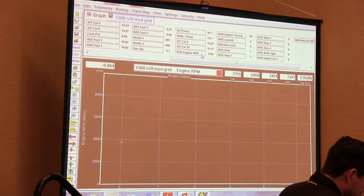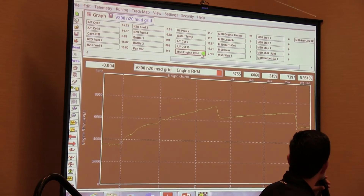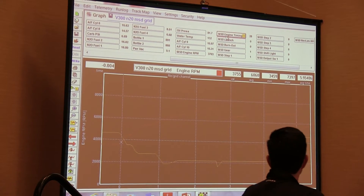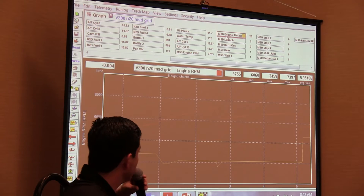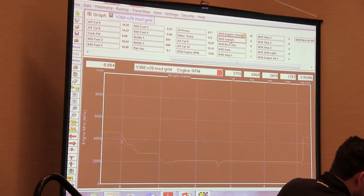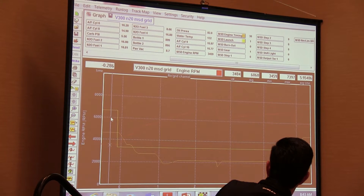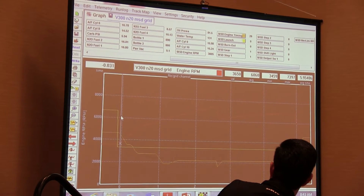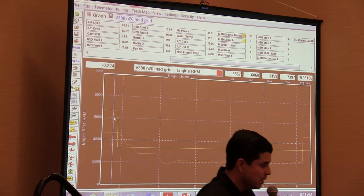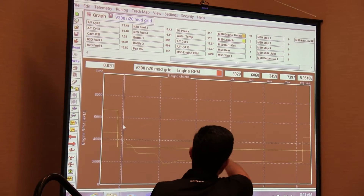Right here, if I click that — it's hard to see — but you can see the engine RPM is overlaying on top of what we're receiving from the ignition box. Here is the timing trace being overlaid on the run from the MSD box. Here is the launch input — this is where the driver was activating the trans brake button. You let go, and now it's off. At the top where the channel is, it says one — that is active. Zero is not active. As soon as he lets go, that channel goes to zero and the line drops off.